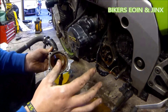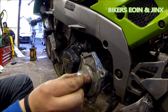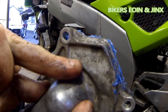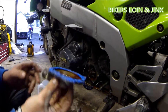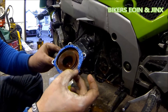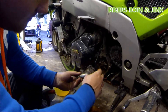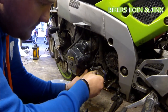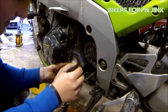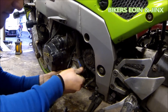I'm going to get this cleaned up and show you how to put it all back together with the sealer applied all over the water pump exterior. I've put the gasket sealer on basically because I couldn't find the seal itself, so make sure all the surfaces are cleaned so it sticks a lot better. Note that all these bolts are different sizes, so be careful to put the right ones back in the right places.